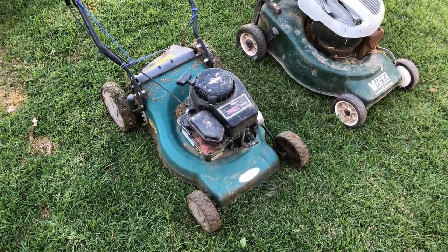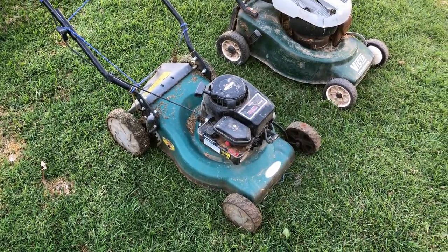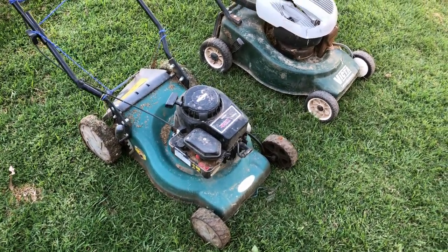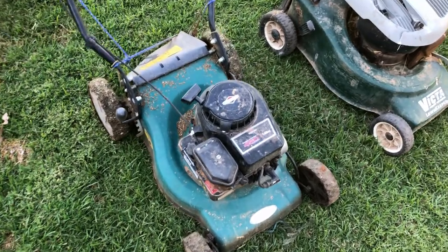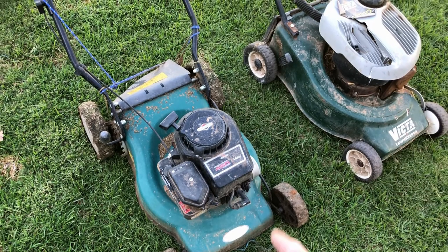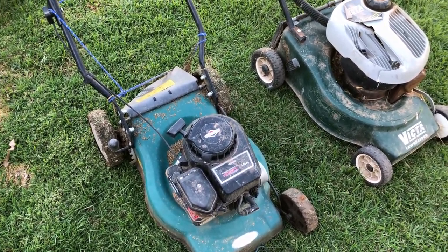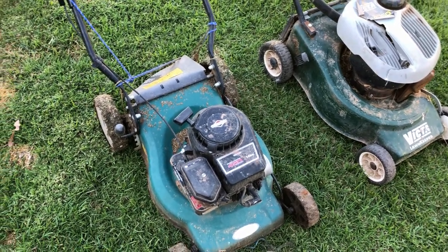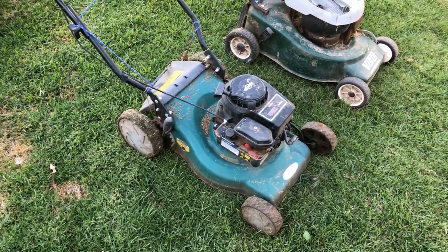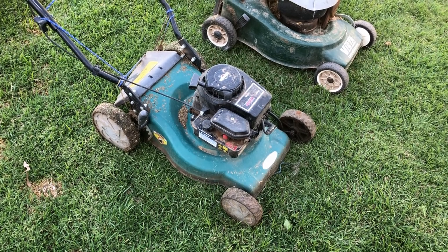So, it's not far off being your basic Honda-powered Bunnings big box store bargain basement mower, except it's got the Briggs & Stratton 148cc on there. Technically speaking, that 450 is a torque rating now instead of horsepower, so it's about 3.5 horsepower. On a 16-inch frame, running properly, it should cut the grass quite well. Flimsy frame though, best suited to little yards.